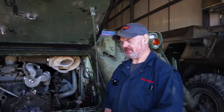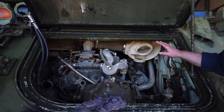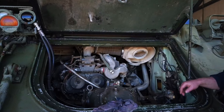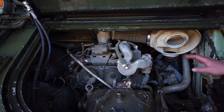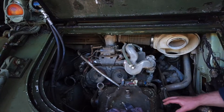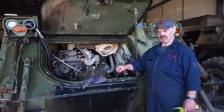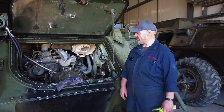We're standing here at the front of the vehicle again, looking at the front of the engine. We've disconnected the airbox and air filter. The exhaust manifold is pulled off the front of the engine that goes out through the muffler. The front driveshaft between the transmission and the control differential has been disconnected. We still have to do some of the cooling lines underneath, and we're just in the process of removing the large oil return line that takes the control differential oil feed back to the transfer case for cooling purposes. That's the one that's slowing us down right now.